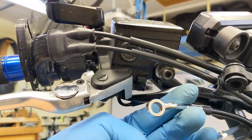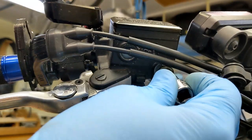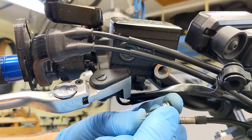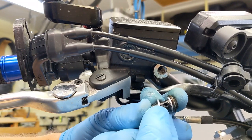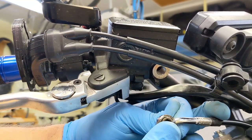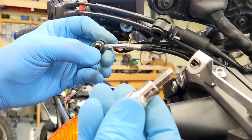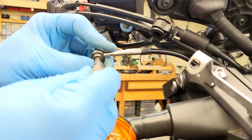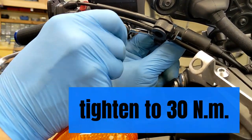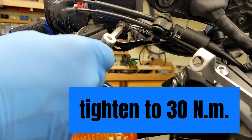You can get different color fittings — I originally bought blue but I like just the chrome. There's basically just one bolt you spin out here, and then there are two crush washers. There's the hole where the hydraulic fluid goes through, so you put one washer on each side. I like to have a six-millimeter to hold it so I can push and turn at the same time, because you definitely don't want to cross-thread this. I'm just carefully spinning this in and I'll snug it down for now, then torque it to the proper torque later.